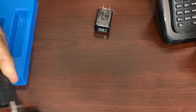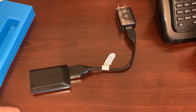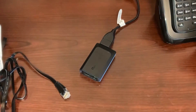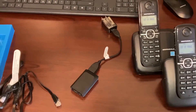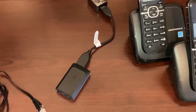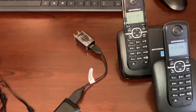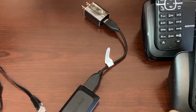I can connect the MagicJack device directly, or use a dongle, which adds a little more flexibility. I actually like this flexible setup so that the device won't break from the USB connector. I will also want to connect the MagicJack device to the internet router — I do need high-speed internet for this to work. Remember, doing all of this is just so I can make the home phones work. If you don't need the home phones to work, the app itself would work fantastic.